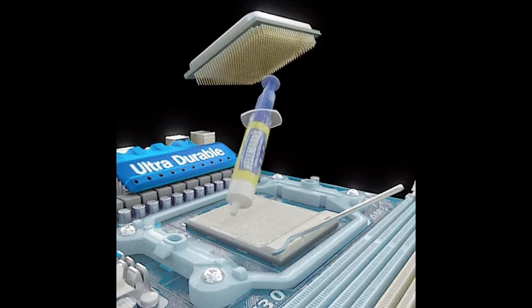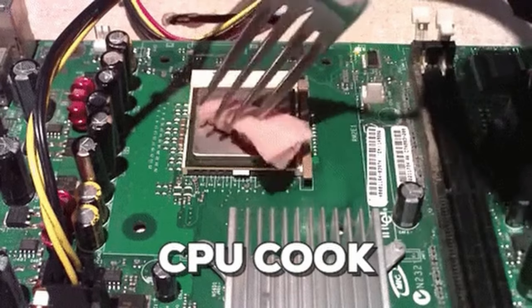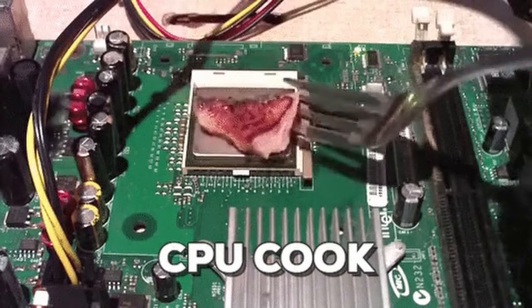Choice should always first come down to the cooling requirements of your chosen CPU. Some CPUs, especially in the age that is upon us, are just guzzlers of power, and where lots of power is used comes the concentration of heat over the IHS of our chosen CPUs. That being said, a general guide would be, for an i3, i5, i7, up to a 7600X, 77, if there exists, 78, I would probably shy on the verges of, say, a 240mm radiator or air cooling. That would be adequate for a CPU of those calibers and levels.